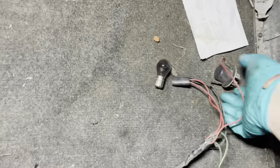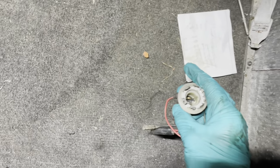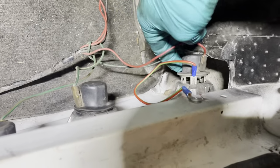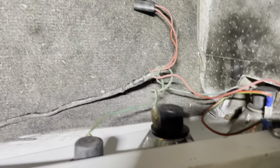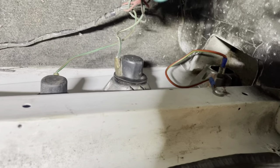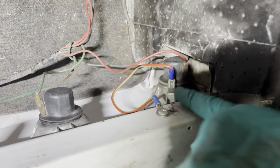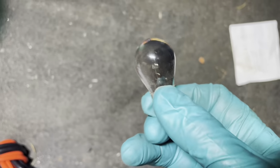So here we are. So the bulb, well, it was an easy diagnose, the bulb's gone, so it's an easy fix. But the bulb sits in there, and then that clasp fits into the housing, like, well, you can see already, it's a bit awkward. Right, there we go. Your earth is here, and that earth's the whole of that unit. So the earth for the bulb goes through these bayonet fittings and makes contact there. That's usually the main fault there. If you're getting lighting problems, it's to do with the earth join either there or to the body. But luckily, I don't have to faff around with any of that because the bulb's popped. Lovely jubbly.